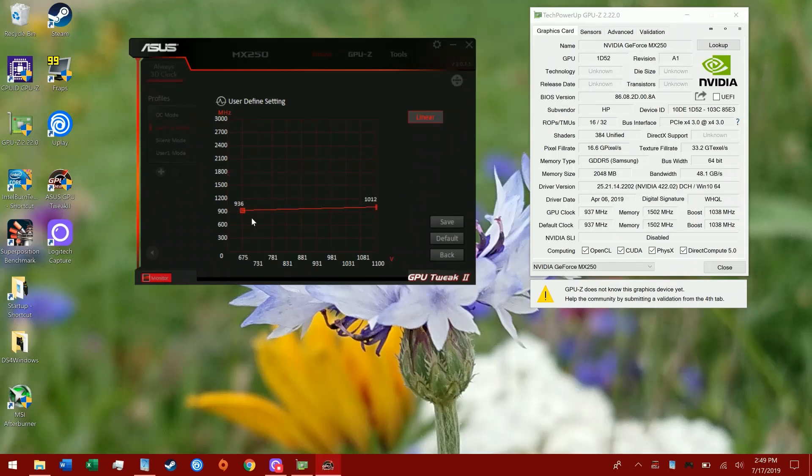You just move the voltage curve so it's a straight line. Mine was stable around here - but it has to be exactly straight, these numbers need to be the same. What that does is it makes it instantly boost to about 1260 MHz, and since it's not moving up and down - since it's linear - it will use the bottom voltage effectively. You just did a minus 500 millivolt undervolt, I'm not kidding. What this does is turn this into an eight-watt mobile gaming graphics card. It's absolutely ridiculous - this actually works. Save those settings.